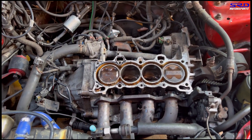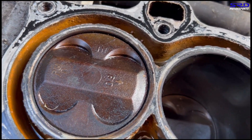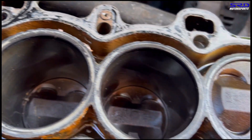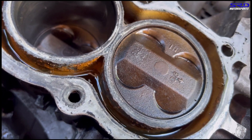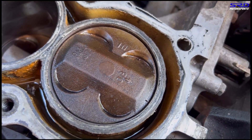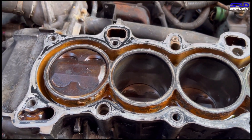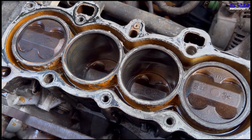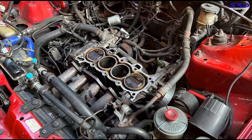The head is coming off — look at that. If you can't get the PM0 or PH12 pistons, the PM7 or P29 is much the same. I prefer the PH12 because it's local, cheap, and it's a mid-dome, not as high. Also — always run engine coolant, because when I ran out and started putting water, it started rusting up again on the water jackets.